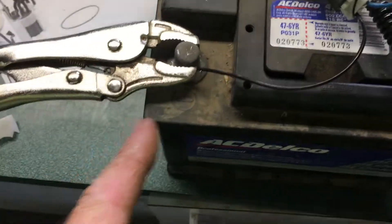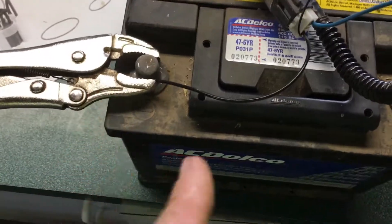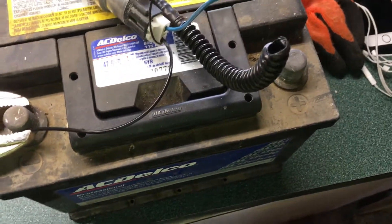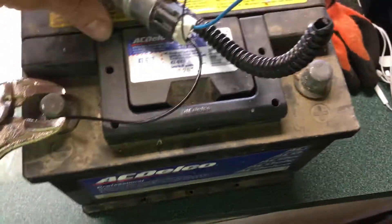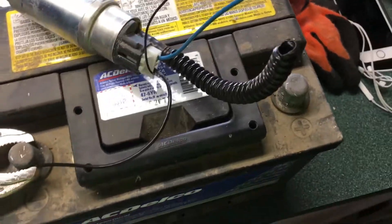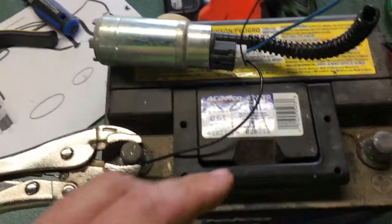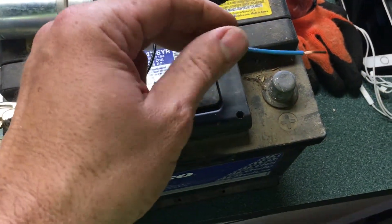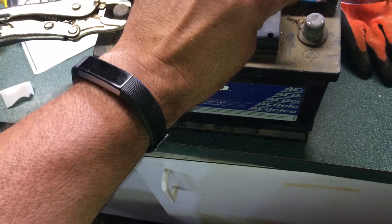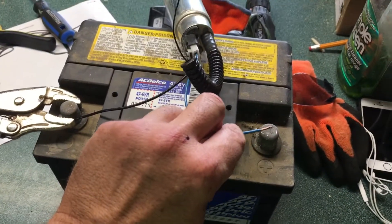Now for the bump test. I'm using a vice grip on my battery terminal. Battery tested out okay, full power, no fuse in line. I don't think the pump short-circuited because we didn't blow any fuses in the car. I'm just going to give it a tap and see if the pump turns over or if it's a locked-rotor scenario. Clicking it now — it does run!